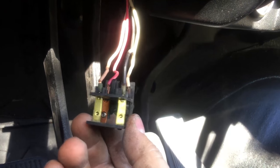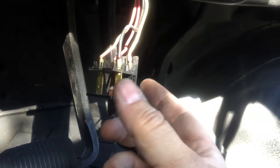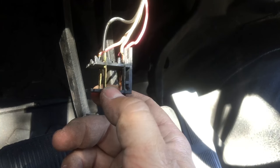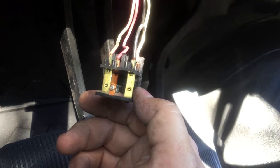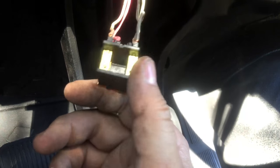I'm going to wait for the new one to come in, get this cleaned up and put back together. I thought it'd be interesting to show you what to look for because I was racking my brain for days — chasing wires along the side rail, unbolting the tail lights from the back of the Jeep numerous times checking for ground issues. Finally I decided to just crack open the switch and there it was: that one leg is really corroded and the rest are perfect. It's probably creating a small arc each time the brake is pushed, and after 20-plus years that corrosion builds up — similar to what happens to a battery.